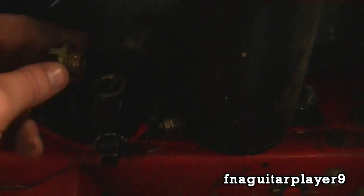Even though I'm waiting until after I'm done cutting grass to change the oil, always check your oil before you cut grass — that way, if you're a little low, you can go ahead and put some in. On this type with the oil plug, Briggs recommends filling it up until it's overflowing. I kind of disagree on that. I like to put it somewhere between the top and bottom notch — about halfway between — that's about where I run it. If you fill them up to the top, your oil slinger gets flooded out and can't sling the oil properly.